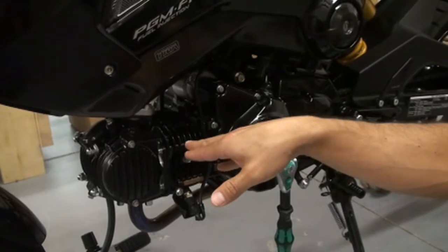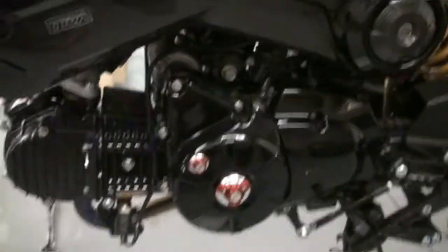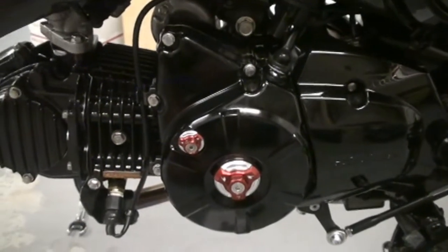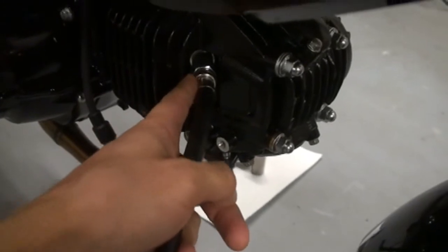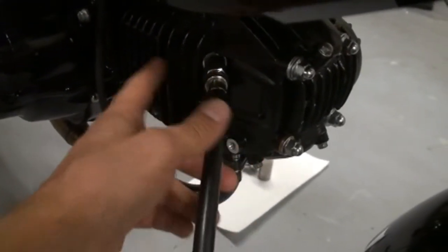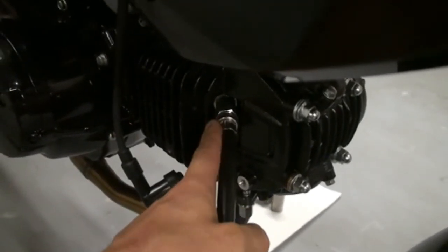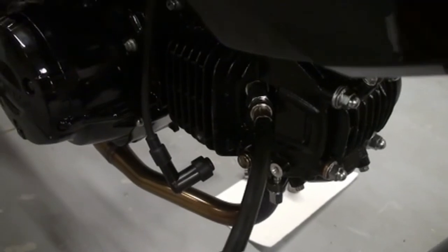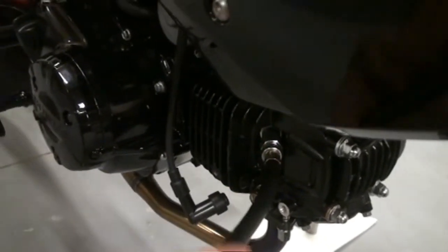This is your first test to make sure everything's going on inside, and then your other one will be a compression test. Next step is to put your inspection covers back on - don't forget to do that, you don't want oil shooting out the side. Still with your motor hot, you're going to put in a different hose. This hose looks nearly identical to the other one, but the biggest difference is it has a little one-way Schrader valve in it - pretty much the same thing as on your bike's valve stems. That one-way valve means that when air presses through to the gauge, it doesn't go back into the cylinder. That's the biggest difference between a leak down tester hose and a compression tester hose. You can remove that valve with a valve stem remover and basically have a hose that does both.